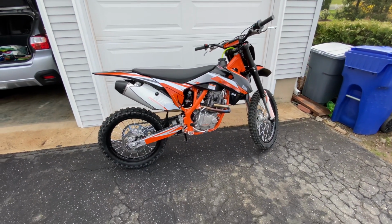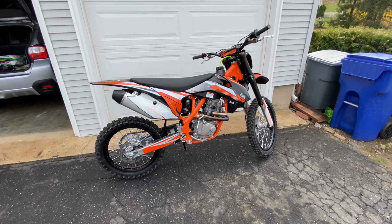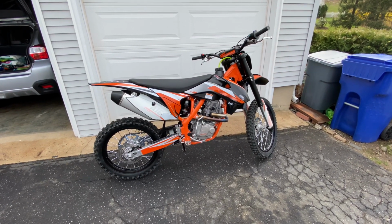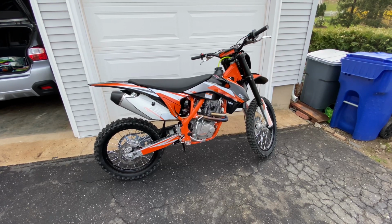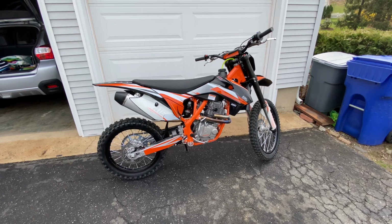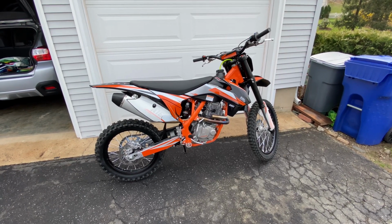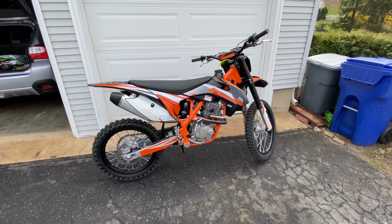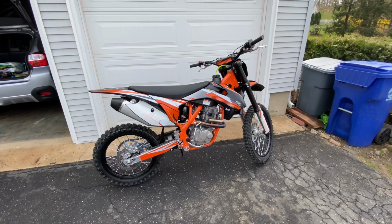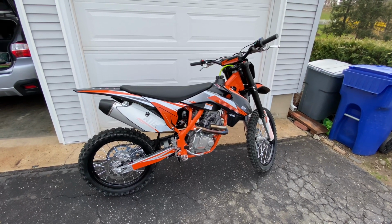Leave some comments if you guys want to know some more, because I will be messing with the jets very soon. I gotta just go to my local place, which I'll probably do today, and I'm gonna get a couple different jets and toy around with it, because once I get it running good here, I'm going to be bringing it up to 2,000 feet above sea level, which might mess with it a little bit, so I might have to do something when I bring it up there.